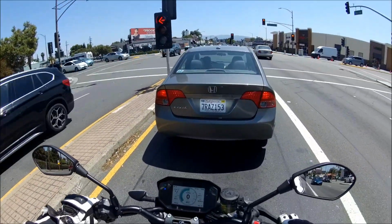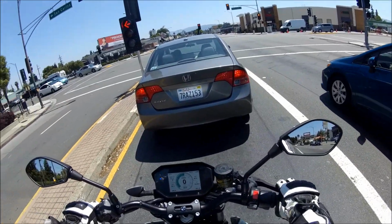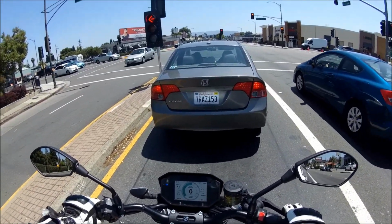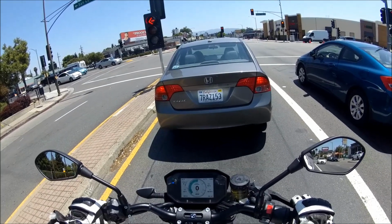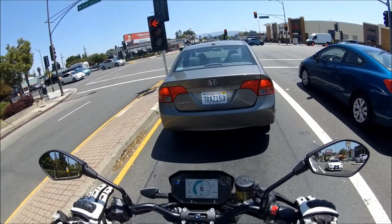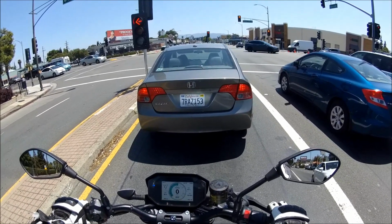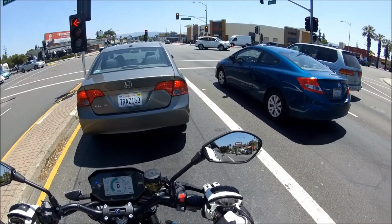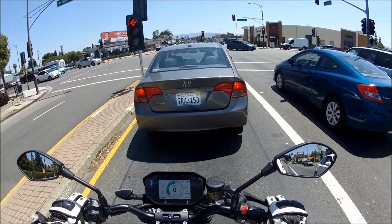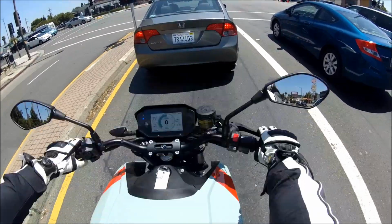They didn't put a level 3 charger, and I would like a level 3 charger, I'm not gonna lie. There are level 3 chargers out there where you can charge your bike really fast. But level 2, 6 kilowatt, is your limit. But you can find a lot of J1772 charging stations around the city, so they're easier to find. They're more plentiful than level 3 chargers. So that's why I like this better.